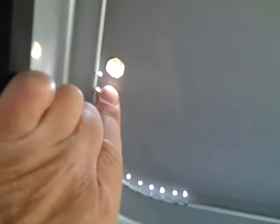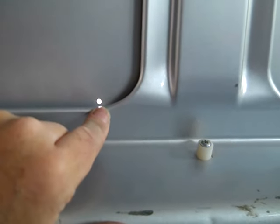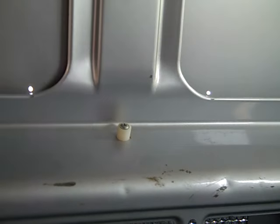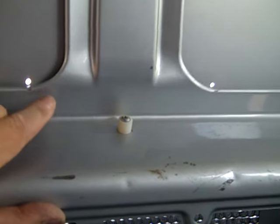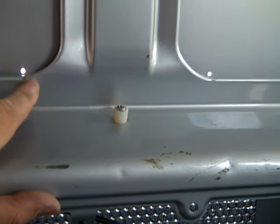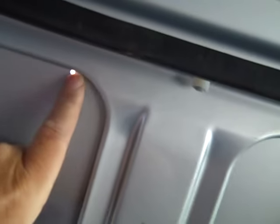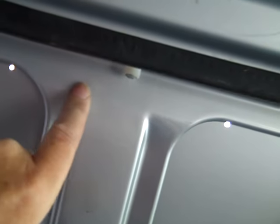Right, there's my big hole to put my saw blade in to give me a start when I start to cut. I put a hole here and a hole here. That's so when I'm outside cutting through, when I get to them holes, I know that blade's going to slow down, because I've got to cut through that strengthening rib. I've done the same at top. There's a hole there and a hole there. So on outside, when I get to there, blade's going to slow down because I'm cutting through two skins. But that's what inside looks like.